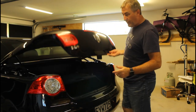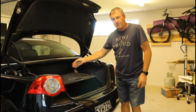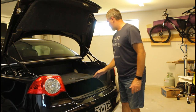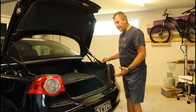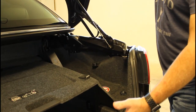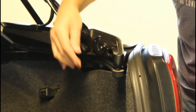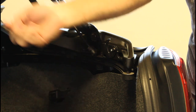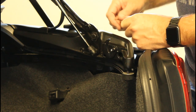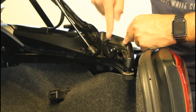So to explain a little bit better, let's look at the boot first. The first problem you will have is there's obviously limited space in your boot — you've got a tiny ski hatch you've got to try and get through, and you've got to move the cover out of the way. You've got to get to these two C locks, there's one on either side. The first phase of a roof operation closes these C locks and locks your boot lid shut, regardless of whether your emergency boot release cable works — it'll release the latch but it won't release these. The covers here just pop off really easily. If you've got a small child who can fit through the ski hatch, that'll solve your problem straight away. But if you haven't got a small person, you've got to work out a way of getting to these latches and pulling them open.